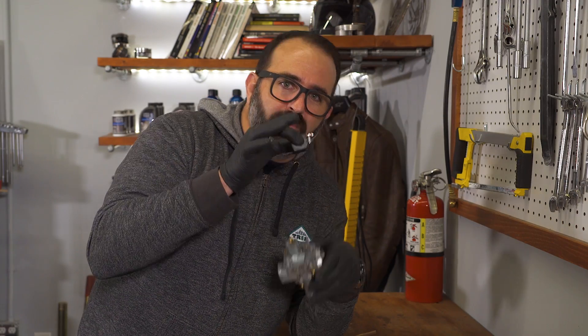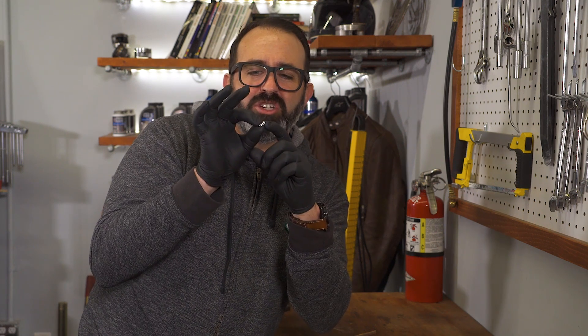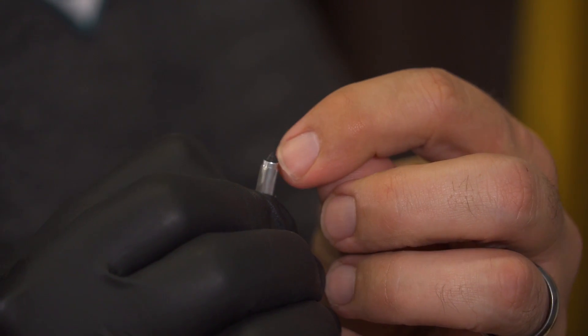The next issue is the needle might actually be worn out, also leading to overflowing and improper metering. When you pull the needle out, the sealing surface right here should be totally smooth. Run your fingernail down that needle — if there's a ridge, it's toast. Replace the seat at the same time as the needle because they usually come in a set at about 15 to 20 bucks.